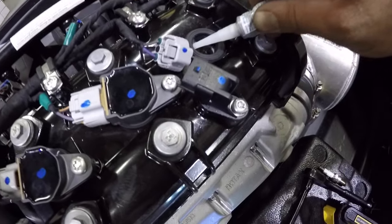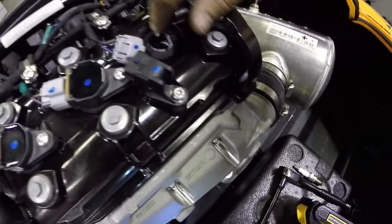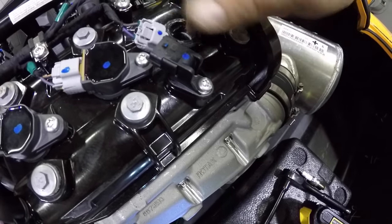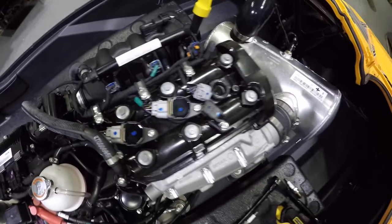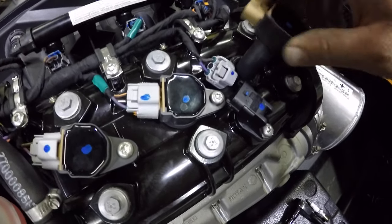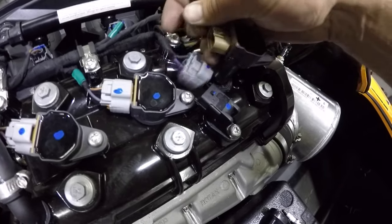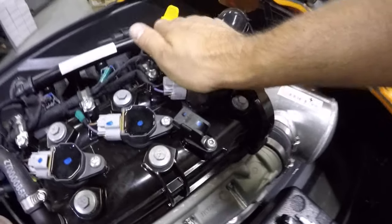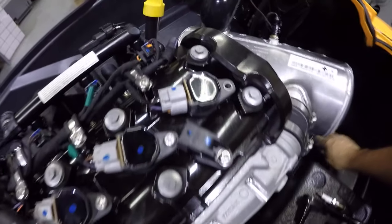Those little impact drills actually put quite a bit of torque when you're taking rusty old screws out or putting them in. You can actually snap the heads right off them. They're pretty amazing. For those of you that haven't used an impact drill, that is definitely something you want to invest in. They're amazing tools. It's not the same as using a drill. They don't strip screw heads as easily, and they put in a crazy amount of torque without stripping the screw head. Because they do a back and forth motion, so they don't just work their way out, they keep working their way out and in, out and in. All right. That little snapping sound. It's awesome.